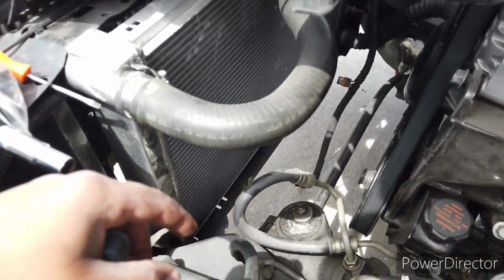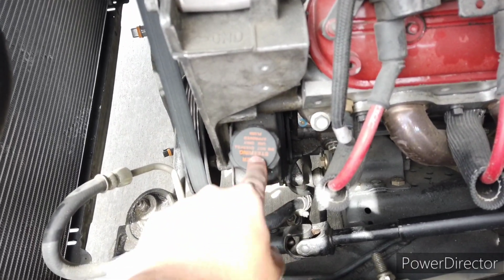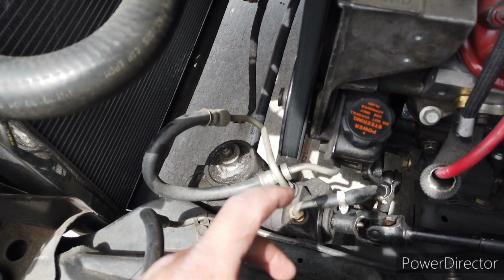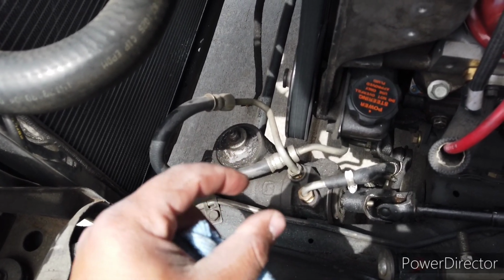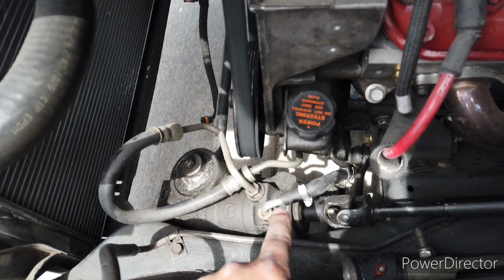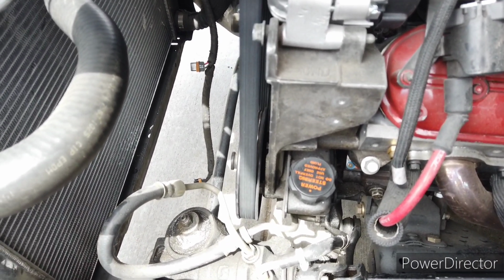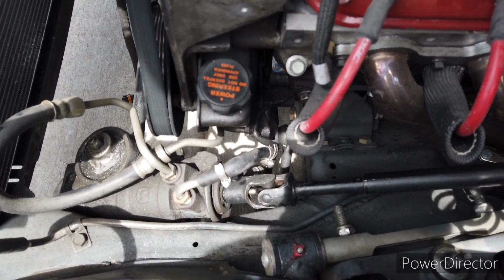And then also eventually going to need to replace the gearbox. I talked to a buddy, and with the LS power steering pump, I think it's too much pressure for the G-body one, so I'll probably get a rebuilt unit, just probably from the Monte Carlo or something, with a little bit different steering ratio. But at the same time, I'll look at getting, I believe they call it a flow control valve, so it'll reduce the pressure a little bit in the lines, so the gearbox isn't getting as much pressure coming off of the steering pump. So I'll look into that. I think it's about a $25–30 part. You know, either just go in here or off of the power steering lines.